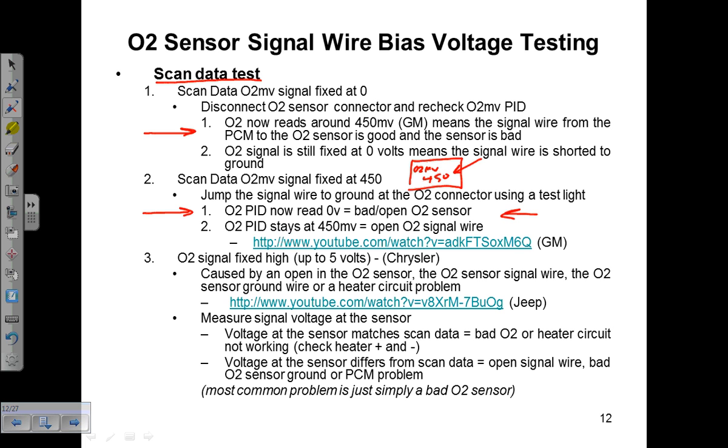There's no reason for the computer to be looking at the O2 sensor with the engine off. So in some cases, on some cars, you need to have the engine running or you need to crank it over. The note we should add is that if you're doing this test, you may need to crank the engine or have it running for a data PID update.